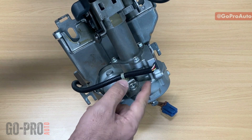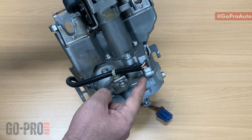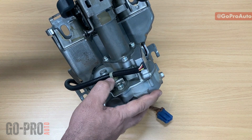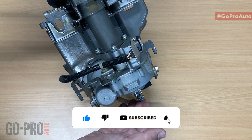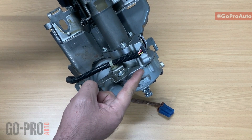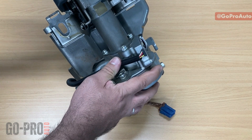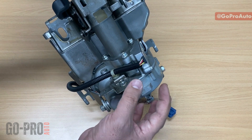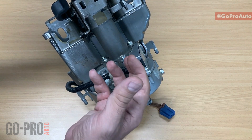When you turn the steering wheel, this torque sensor at the top detects the amount of torque. How? Generally inside this assembly we have a torsion bar — just like the torsion bar in hydraulic power steering inside the pinion rotary valve. When you want to turn the steering wheel, there's resistance coming from the wheel. When you turn from the top, that torsion bar inside the torque sensor assembly gets distorted — generally around seven or eight degrees, which you can also read with a scan tool. That distortion gives the proper signal to the torque sensor.